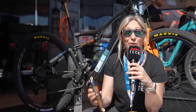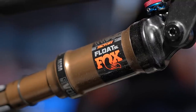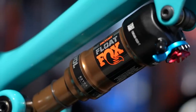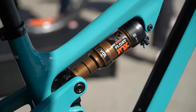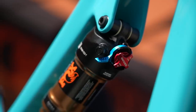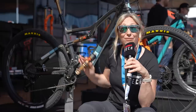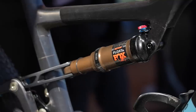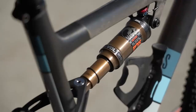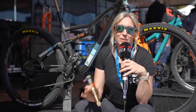Fox have just launched today the Fox Float and the Fox Float SL. The Fox Float is marketed at trail, will replace the DPS, and has similar damping characteristics to the Float X, but loses that external body, making it a lighter weight package for trail riders. We're looking at 100 to 140mm travel. Even lighter still is the Fox Float SL, which has simpler damping technology and is offered at cross country to down country races with 80 to 100mm of travel.